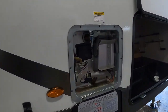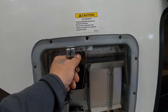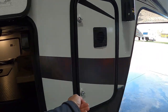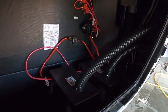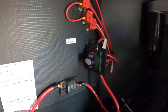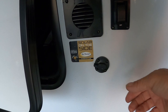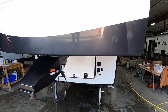Hand crank down for your spare tire. In the storage area, your hot water heater — if it doesn't seem to be working, look to see if either one of the reset buttons is bubbled up. If they are, press them back in there to reset. This is your pressure release valve. A couple of override hand cranks — one for your spare tire, one for your slides. Propane is here. Check your battery posts every now and then — make sure nothing's wiggled loose over time. This is your battery disconnect, which will disconnect all the battery power to the unit. There are hydraulics for your slides, more docking lights up front, vents for your batteries to get air, and you're prepped for solar — you can plug in a solar panel right there.